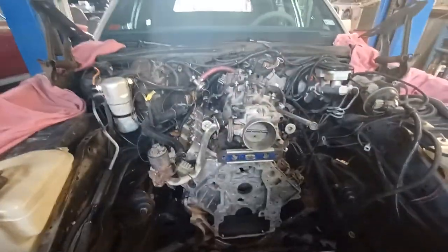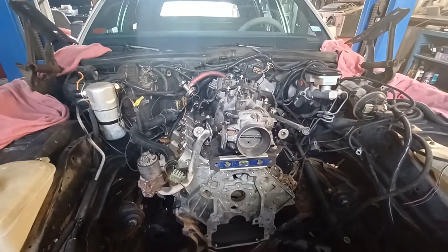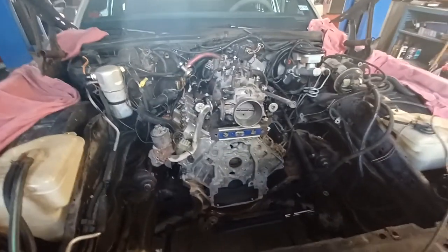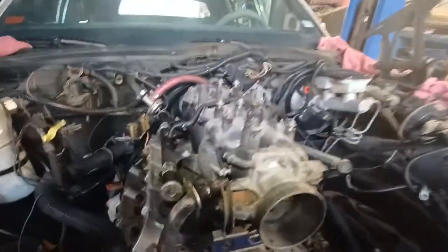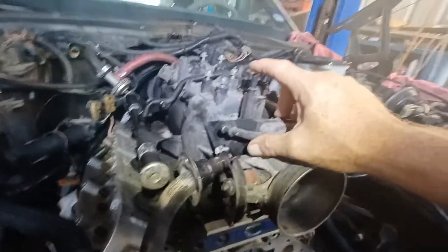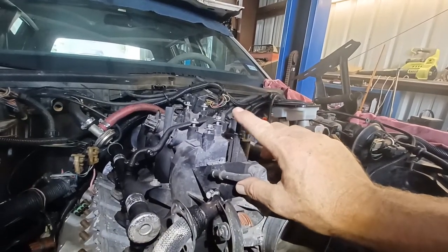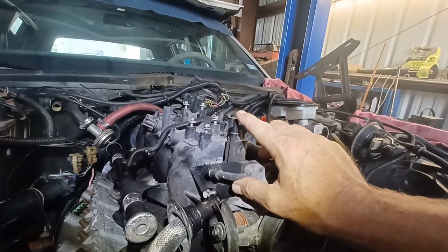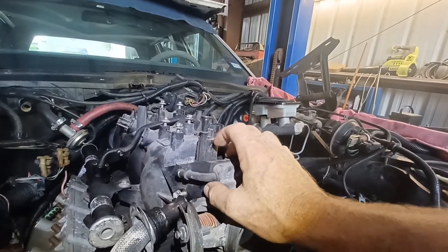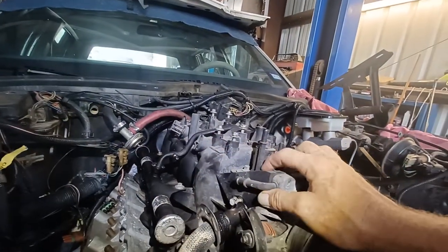Back to the fitment - this is the truck intake manifold and I watched Snyder Tron's video; they used the exact same setup. I was trying to get the engine sitting exactly where they did, and I still had roughly about a quarter of an inch before it even touched the insulation on the bottom of the hood, so that works. The purge valve here is no problem because we're getting rid of it completely - I'll either tap and plug that hole or get a vacuum line over to the AC.